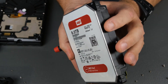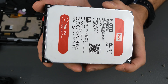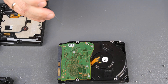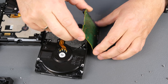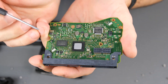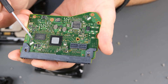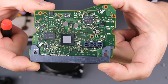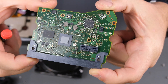Let's take a look at another drive — this one is a helium-filled drive. This one uses completely different technology because it has different heads, different platters, different logic board. The track here is thinner, so it needs more accurate positioning on the track. It has faster speed at 7,200 RPM. And here, we find two sensors on two opposite sides.